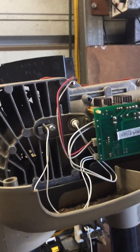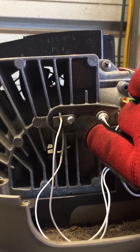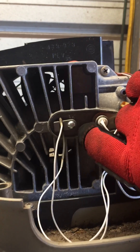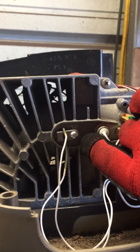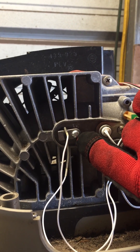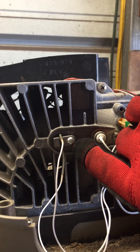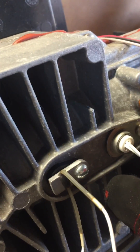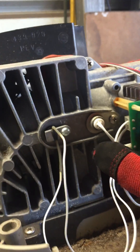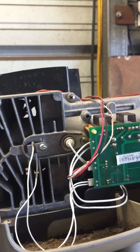Simple repair — all I did was remove the cover, drill out the plastic insert that's inside the manifold with a small bit (very easy to do, it was brittle anyway), then I found a simple regular threaded screw, put the thermistor back in place, and screwed it in. I didn't even have to thread it because it's aluminum — it kind of bites on its own — and voila, the unit works like a charm.